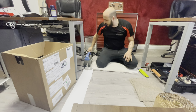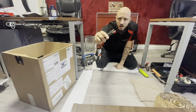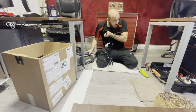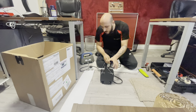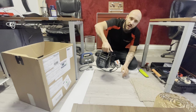Right. The adapter is an American adapter. Like, the plug is basically this. It's a 3-pin plug, and the wattage on this, you can't plug this into your normal UK socket, otherwise it will blow. You do have to get a transformer. And this transformer is a step up and a step down transformer, so it's a 110. So if you can have a look at that.